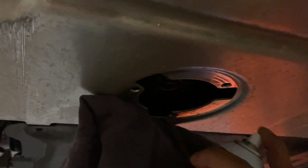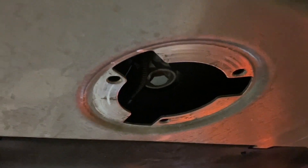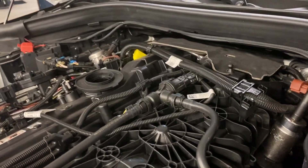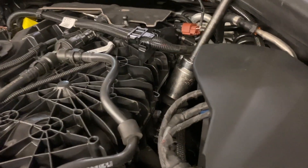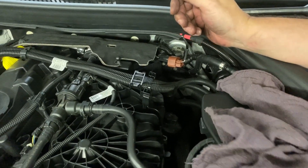We're going to clean this up and get all the oil residue off using brake cleaner. We already torqued the drain plug down. We're going to leave the black plastic piece off and recheck after we put the fluid back in to check for leaks. Now we're going to use the 32mm socket to break the filter cartridge loose - getting some leverage on it.